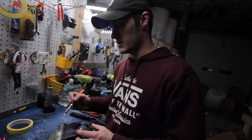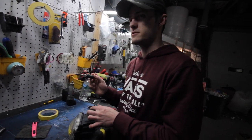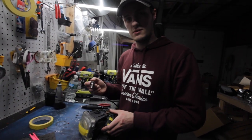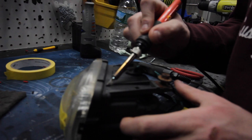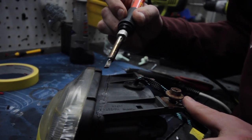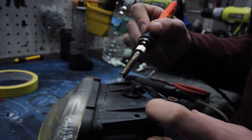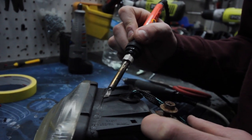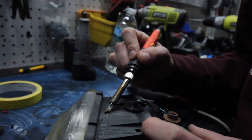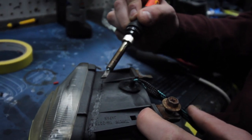So what we're doing now is plastic welding the rear cap back to the front. We're using a soldering iron — there's apparently some special gun thing out there you can use, but right now we're just quickly going along the edges. What we're essentially doing is melting the plastic back together. If you have the ultrasonic cutter like we have here, you're really in luck because your gap is very small. If you're using a Dremel and your bit is wider, you might have a tougher time sealing it — it's still doable, it just takes more work.